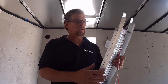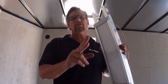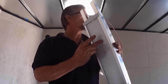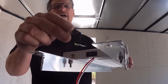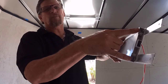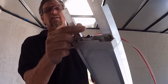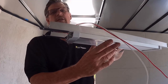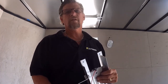A quick word about the panel lights we're using: these are 18 inches long and typically are going to replace a 2x T5 12-inch fixture, but will be about twice as bright. These are a cool white - the color is 6000K - they're also available in a natural white at 4500K. They do have removable end caps that come off so you can access the mounting holes, and once the caps are back on you can't see the screws that hold it up. It comes with wood screws - just pop the cap off, put it in with wood screws into an RV ceiling or wherever you need it, put the caps back on, and it's a really clean look.